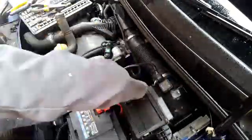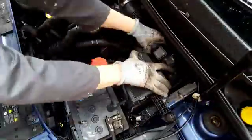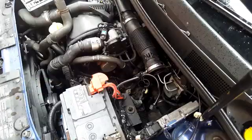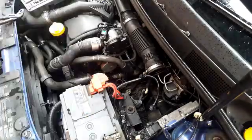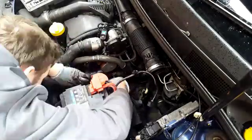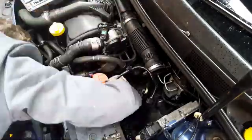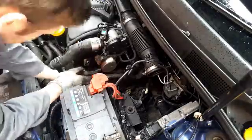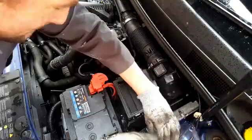When you do this type of work you will lose some coolant — when I removed the coolant hoses I lost quite a bit, which I then had to top up. I purchased a brand new thermostat off eBay with the same part number as the original. You need to make sure you buy the thermostat with the correct temperature sensor for your car, because there are two separate types of sensors depending on what harness you have.